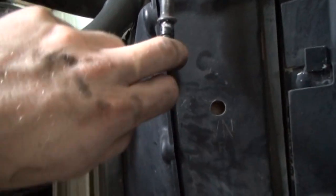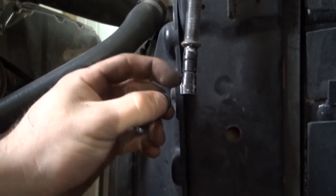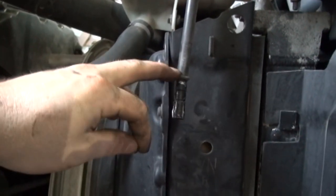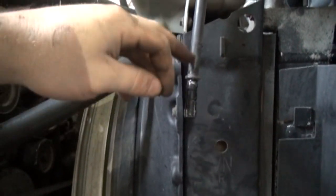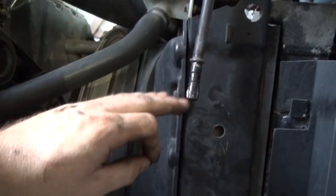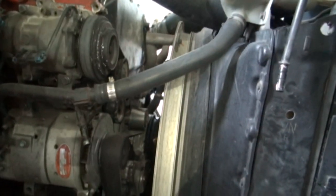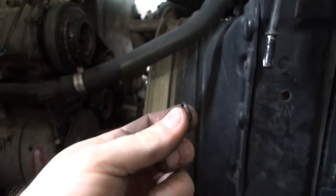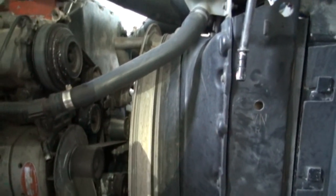Okay, guys, I finally got that off of there. I damaged this fitting a little bit cutting into it. It's got two O-rings that it's supposed to seal to. I did buy a weld on end also. If I boogered this up too bad getting it off, I could just whack it off and weld a new end on it. But I'm gonna try it just like this for now, and I'll see how that works out. That's the O-rings that come off of it. I'm gonna go over here and get some new O-rings and put on there, and then we'll put the hose on and the crimps.